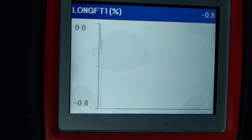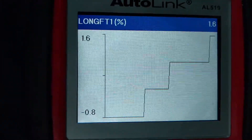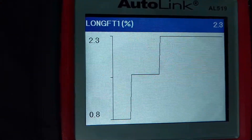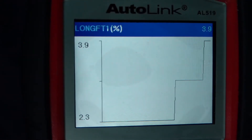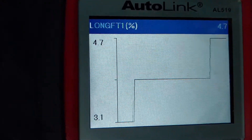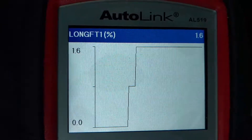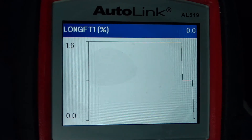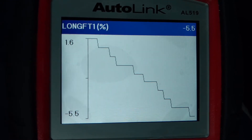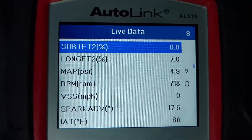I've just held it at 3,000 RPM for a little while and the long fuel trim is taking forever to come back — it went all the way to negative 14 after I came back off the throttle. I've been sitting here a couple of minutes and it's finally starting to raise back up. So how long is it supposed to take the long term fuel trim to react after you give it some throttle? Now it's coming back up to around seven or so — but look at that, it turned right around and started dropping back down again. This thing is wandering all over the place. What's going on, gearheads? Does anybody know what's happening with this thing?